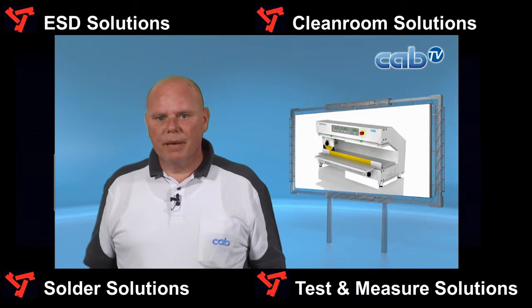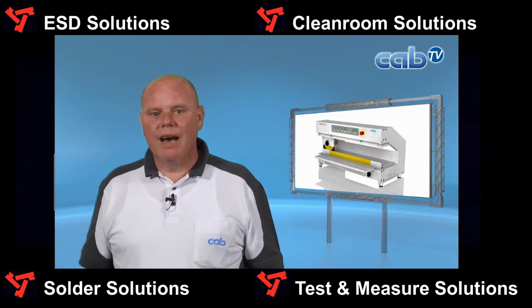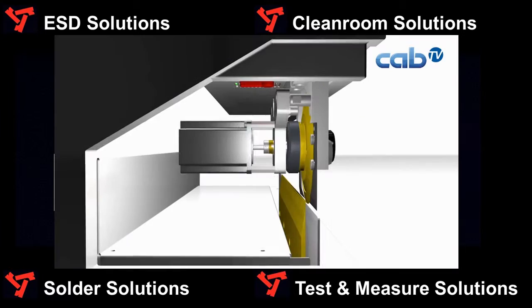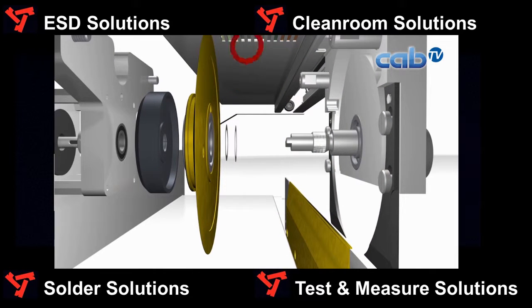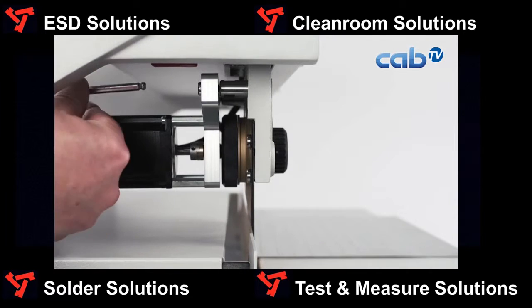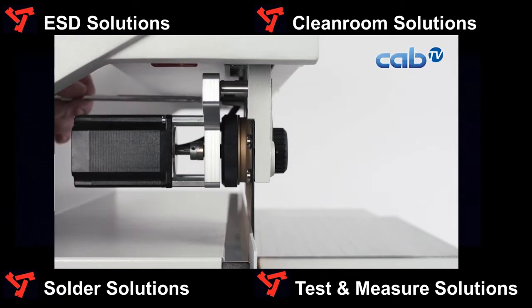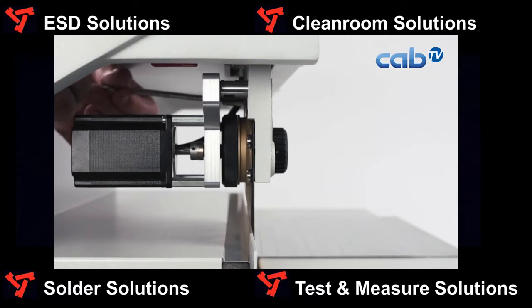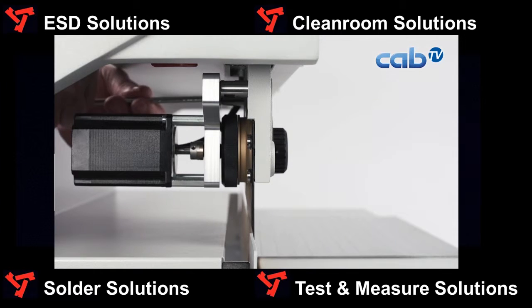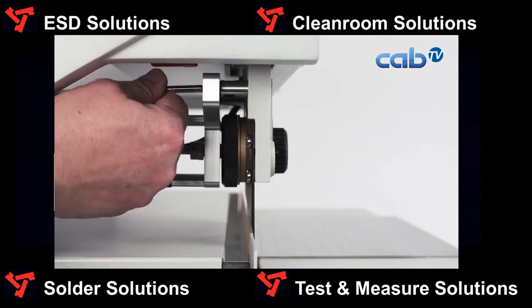Let's now change the blade adjustment. Make sure that there is a displacement between the upper and the lower blade. An easy way to do this is inserting two or three additional washers. I always recommend to check the fixedness of the engine before tightening the screws. Make sure that the engine to the drive shaft is not jammed.